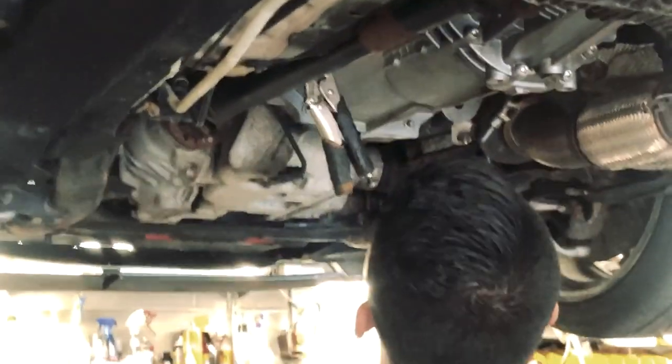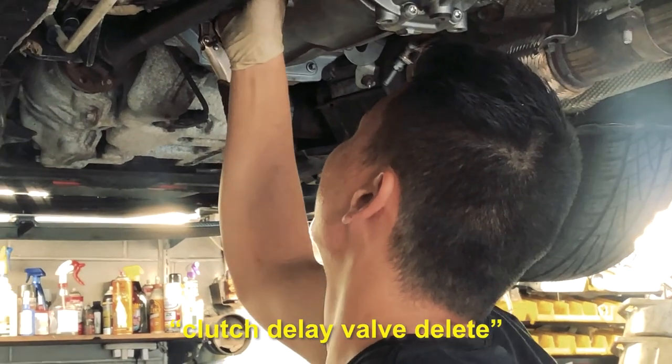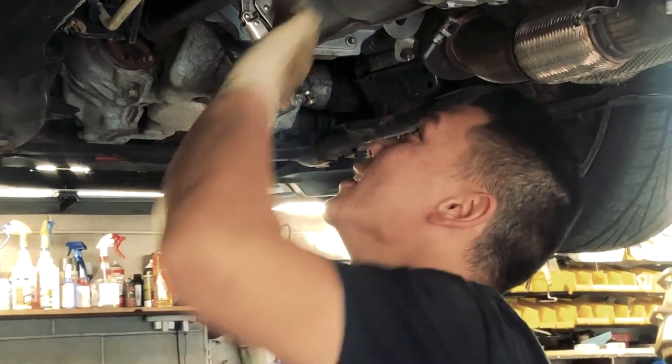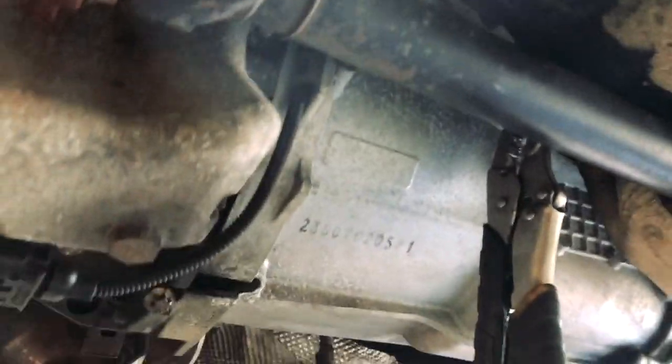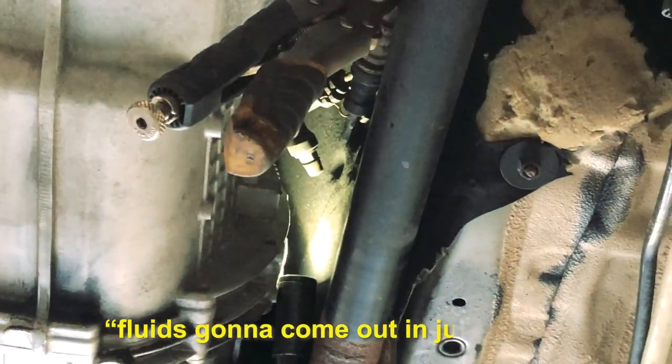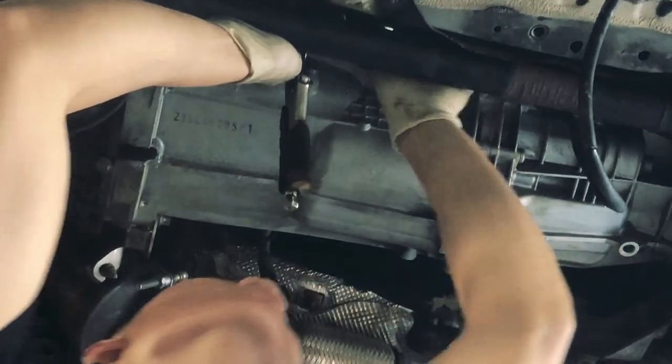Alright Jackie, what job were you performing here today? A clutch delay valve delete on an F33 35 X drive. So the clutch line is pinched and the slave is somewhere right up there. There's the slave — the fluid's gonna come out on his side.